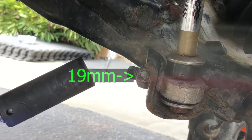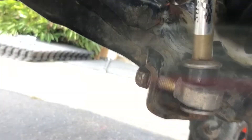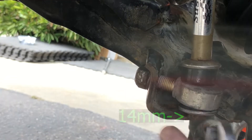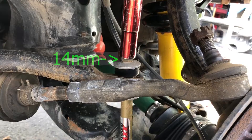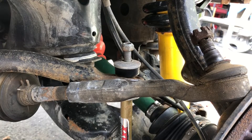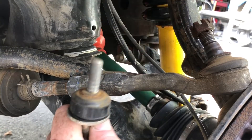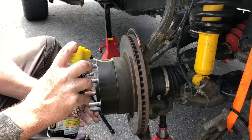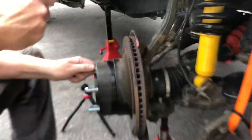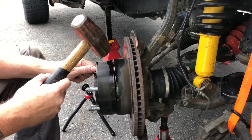Next we're going to tackle the sway bar links. These are Suspension Max aftermarket links — they do what they're supposed to do, nothing special. I'll put a link to a video in the description on removing the stock sway bar links. I've been working on some quick disconnect sway bar links for the front and I think I finally got it, so stay tuned for that video. Now, if you run spacers and you've ever left them on for a while and then tried to take them off, you know the struggle is real. These things bond to the rotors like nobody's business, so I'm just pulling on the studs while I beat it with a hammer.